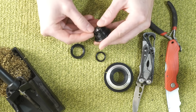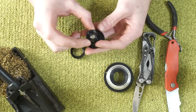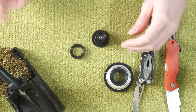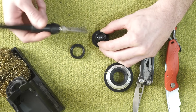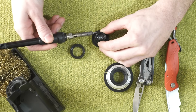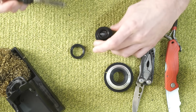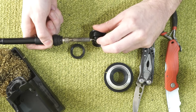And once that's aligned, which it feels like it is right now, I'm going to take this ring, which simply sits around that lens element. Now this is a case in which I do need to make sure my alignment is good. So I'm going to tap a weld on this side. I'm going to tap a weld around the other side. Now these are the equivalent of just doing tack welds if you were actually welding something. Do a little tack weld over here.